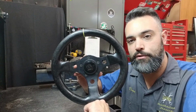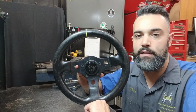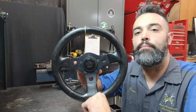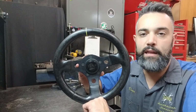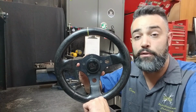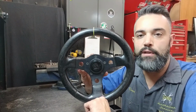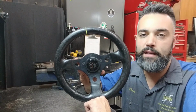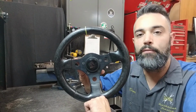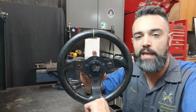And if the stability control module is reading a consistent voltage indicating that the driver is attempting to turn left by however many degrees, and the vehicle is not going left, and the input from the other sensors is saying that the vehicle is going straight and everything's working, the ESC light or the stability control light is probably going to illuminate or flash, and depending on the speed of the vehicle may self-apply the brakes and prevent the vehicle from traveling any further. This is a safety concern.